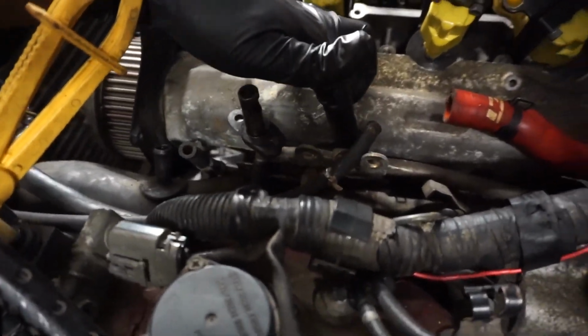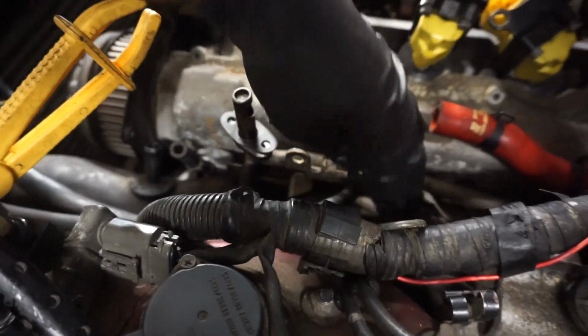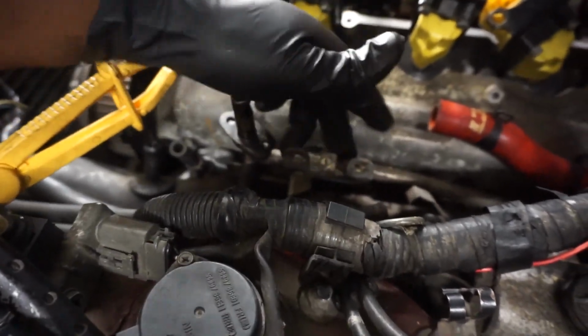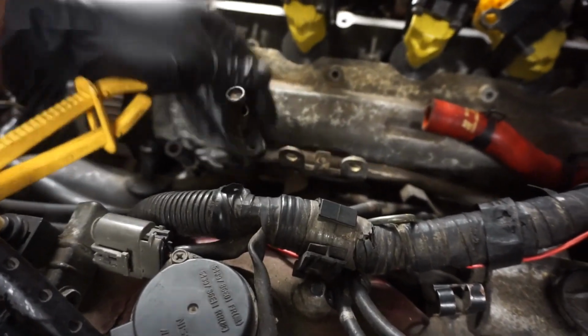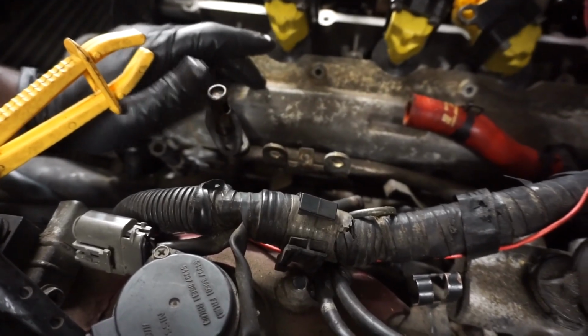this side, because Nissan wanted to put the bolt right here. I mean, you don't even give me a relief where I could just stick. Oh my. I might have to just delete these EGR tubes. Y'all let me know in the comment section if that's gonna be a smart thing. I mean, it's not gonna be a daily driver, not gonna be anything that I have to worry about passing emissions. Man, should I delete this EGR, man? Because I'm just sick of this.